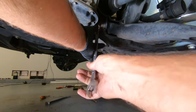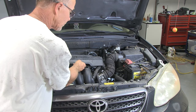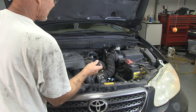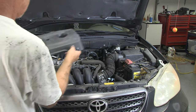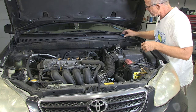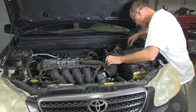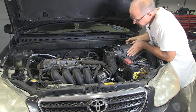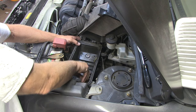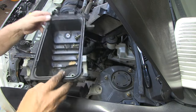This one's only going to come out so much, so right now we need to go up — I need to raise this transmission up. On the top here we need to remove some stuff because we need to get down here and remove the bolts out of the mounts so we can lift that engine up. Once you get these three bolts out of the bottom of the air cleaner box, just pull it up and put that aside.